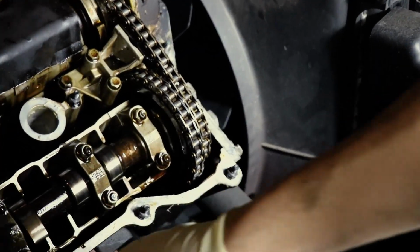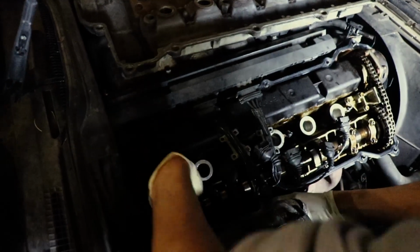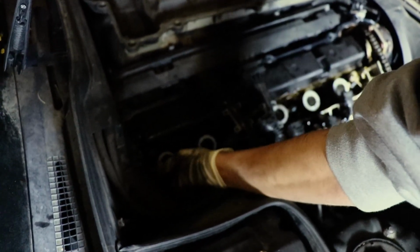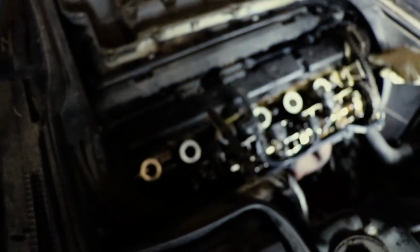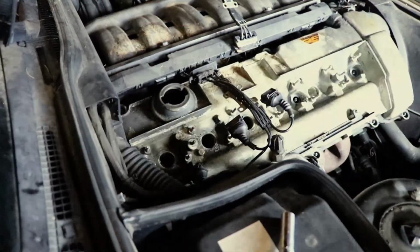All right, dope. I'm gonna go ahead and lay that down. Put a little bit of gasket maker right there on the curve, just for that transition to smoothen it out. Studs to guide you, right? So don't be scared. There's gonna be studs, so we can take this gasket and get it over all the studs and push these curves in and let them grab a hold of that silicone. Cool. So now you've put a gasket on, and all you got to do is put the valve cover on. Put it back down, follow your guides, and there you go. You got a valve cover on.